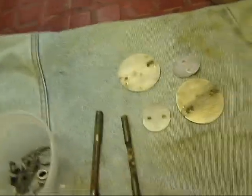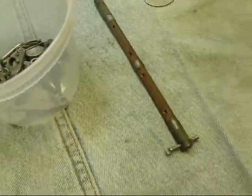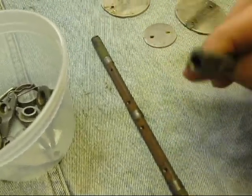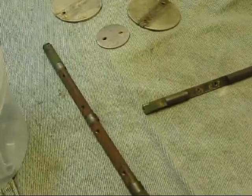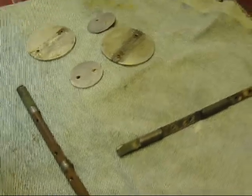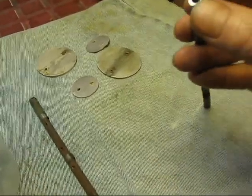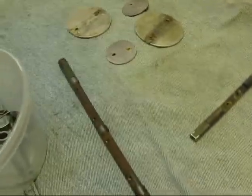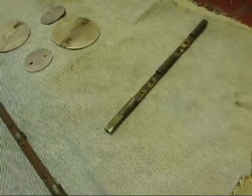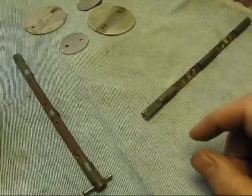Let's get back to the carburetor. These are the shafts I pulled out, and you can see they're pretty rusty. I ground the end of this — you can see that — and I tapped it. This is the end with the throttle shaft, the front throttle shaft, where the butterfly goes. The idea is so that I can interchange the various brackets that the accelerator pedal and springs go to, because on my car I may want a particular bracket. When you take this apart, it's really the only way to get them apart — you have to grind off the end, it's peened over on it.